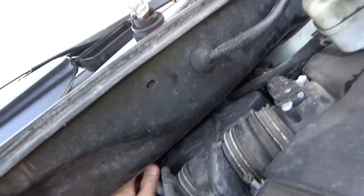I was trying to position my clamps and get the harness out of the way a little bit, but keep in mind, always watch the test lights. Always watch the test lights. And they went out, and now I don't know if I can reproduce the problem. There it is. There, that's the money shot. I'm just touching this harness right here, and that short to ground is disappearing and coming right back. So let me show the shop owner this, and we'll do the final victory lap here. We'll find that short right in that harness.